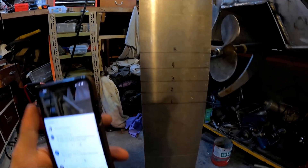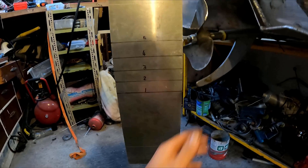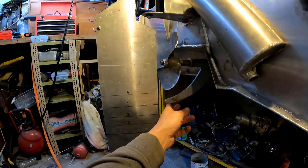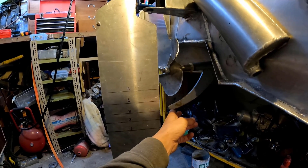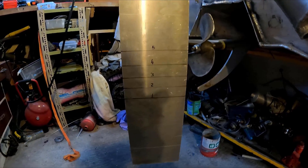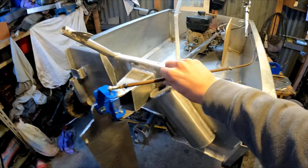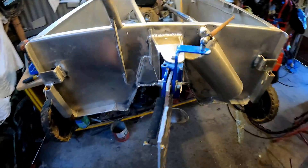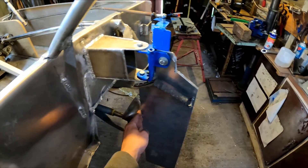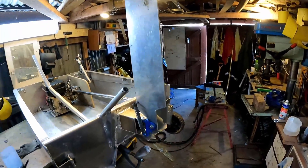I'm going to cut this rudder down. I wrote some numbers on it and did a YouTube Shorts — most people commented to cut it off there since I can always trim more off later. Once you get on the plane you lift the prop back up, so it works more like a surface drive, probably comes up to about there. I've got the steering hook back up with a janky rod setup for now. Put a spring on one side so it rocks out on bumps, and you can go right over center so it sticks up — easy to push around.